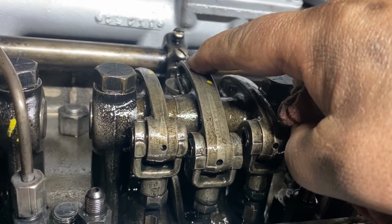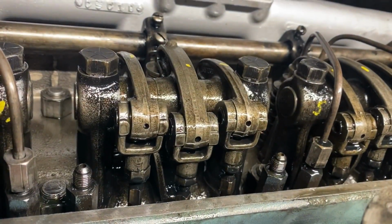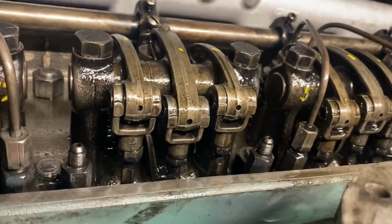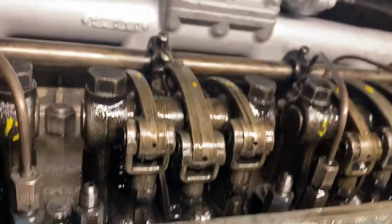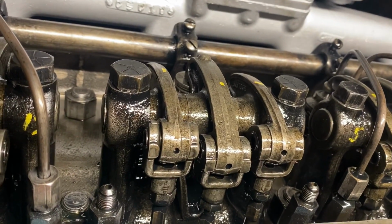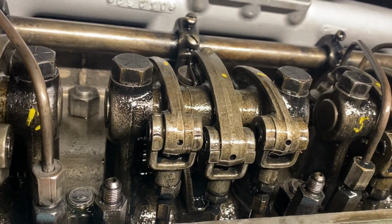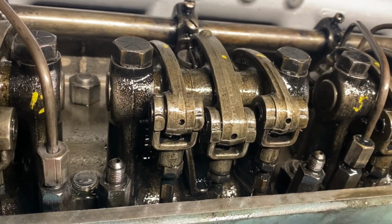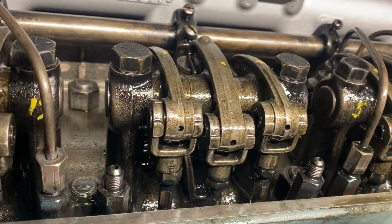We pulled this injector out and ran a compression test on this cylinder, and it's kind of low. It was like 325. But when I ran the engine without that injector in, there was zero smoke coming out of the engine. So whatever is going on is happening on this cylinder. I would spray some fuel in the injector and whack it with the mallet, and it wasn't atomizing, it was squirting more than anything, and I think maybe that is our issue. So we just replaced it with another HV55 injector, and we're going to start it up and see what happens.